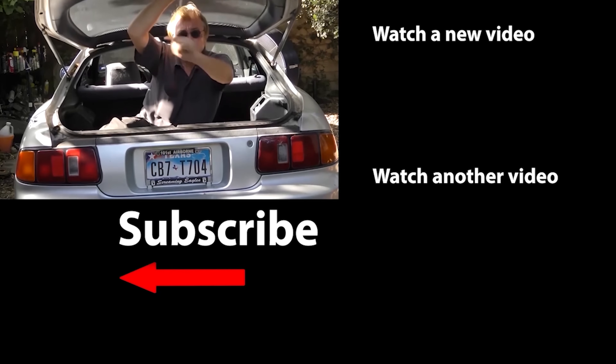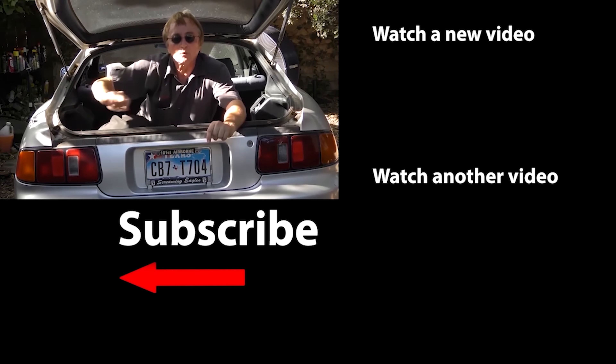Gabe says: I got a 95 Lexus SC400 — it stumbles with a misfire, but only at 1,200 RPM. Already did plugs, wires, and fuel pump. Any ideas? Here's the thing — you don't want to guess. Get a guy like me to hook up a fancy scan tool and analyze it. Unfortunately on a lot of those, believe it or not, the main computer went out. It's very rare for a Toyota or Lexus to have a bad ECM, but on that particular model it happens all the time. The ones I've fixed were doing exactly what yours did — misfiring at a certain RPM. Now it could be lots of other things like a head gasket starting to blow, so have someone hook up a scan tool and analyze it. If he says it's the computer, you'll need to replace it. That's the only model I ever really see have problems with the main computer going bad. If you never want to miss another one of my new car repair videos, remember to ring that bell!